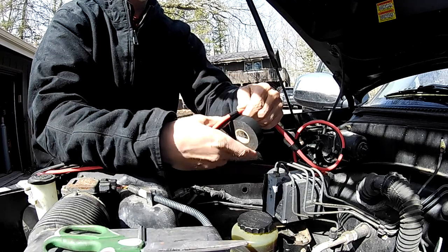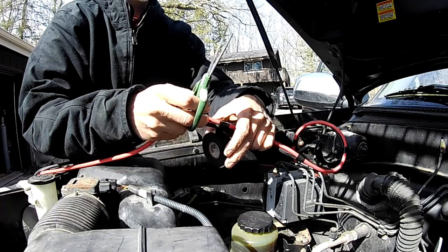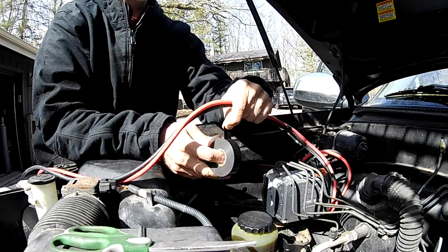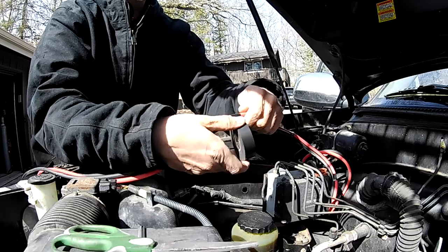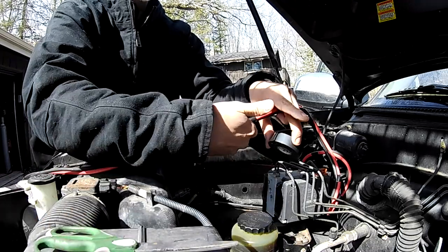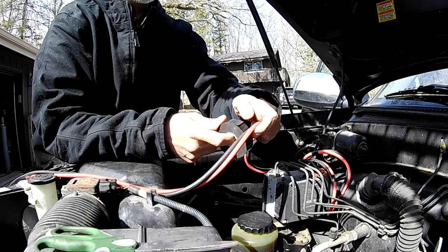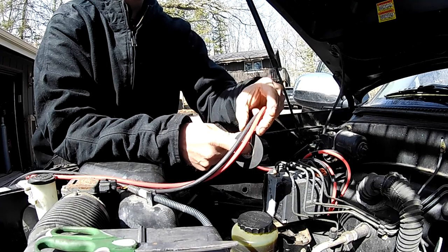The inverter has a built-in circuit breaker so I don't need to put that in. It does have its own on and off switch so I don't have to build that. If I was going to put it remote I would put in a relay with a remote switch. I think I'll do that when I get the camper and run a bigger inverter. I've got a thousand watt inverter, but it's much bigger — that would be more for a camper.